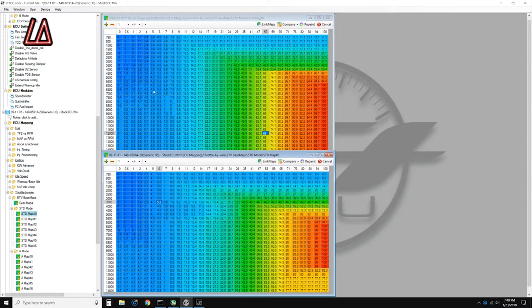The other thing to recognize is that the throttle percentages are not linear. It doesn't go from 1% to 2% to 3% all the way through — it begins skipping. It goes from 9% to 11%, then 12% to 14%, then 14% to 17%. So you don't have a cell for every percentage, and you have to accommodate for those jumps. You have some pretty substantial stepping from these cells that gets you up to 100%.